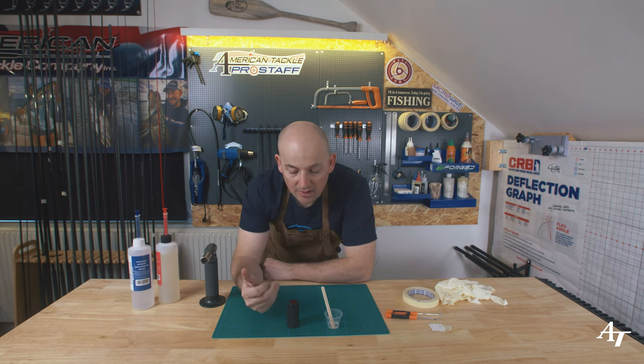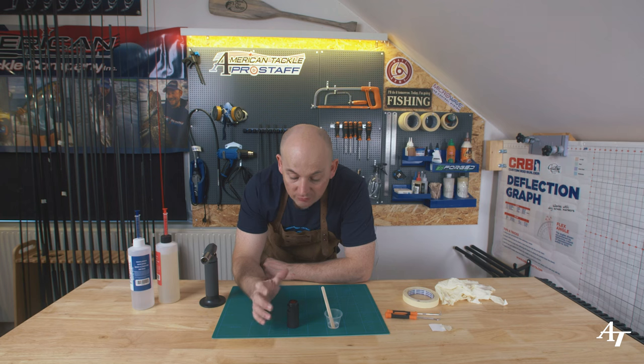Okay. Now, when it's like this, the one thing I would say is you need to make sure that the underside of the butt cap is sealed. Sometimes these kind of butt caps will have a gap. The rubber isn't very tight to the metal plate, and it will dribble through. So you're going to see issues if you have that. This one here is very tightly sealed. So just make sure you check the butt cap when you're doing it.